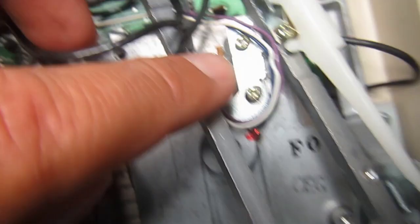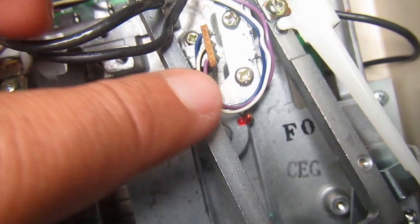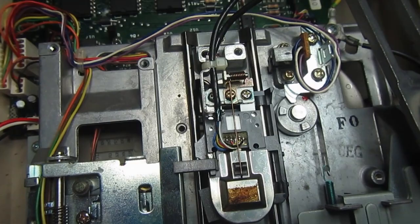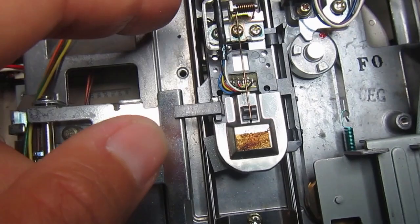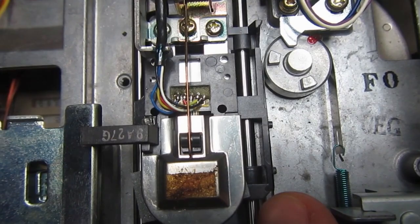Of course you have to cut the plastic tie wrap which secures the conductors. I will replace this tie wrap later. I replaced both rails. When you do this operation, take the time to completely clean both rails, add a drop of oil, and then carefully replace the steel band inside the two plastic pins. Now I will put everything back in its final place and the drive can be tested.